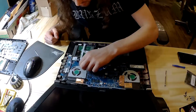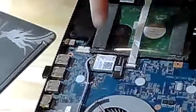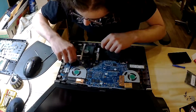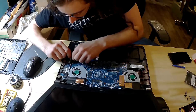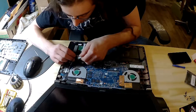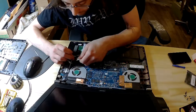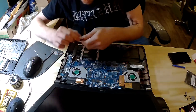I can already see where the Wi-Fi card is, right here. Looks to be a Phillips screw. It just slides out like this. You can pop these antennas off — they just pop off. Remember the order; you probably don't want to mess that up. With the laptop facing the right way, first comes the white wire, then comes the black wire.